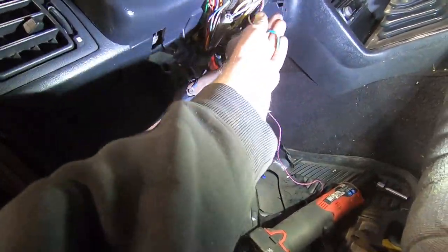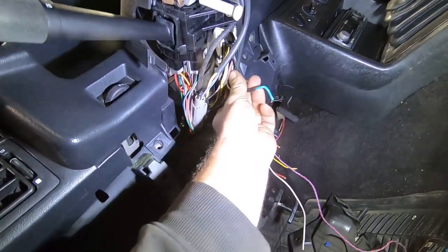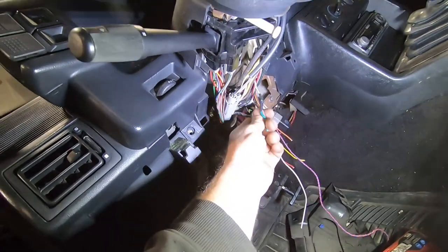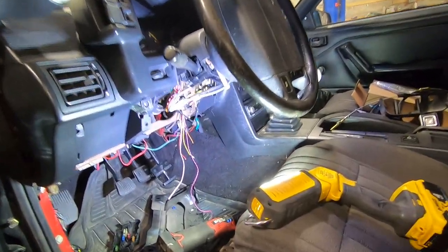All the same, the normal wires are tapped in here. I'm going to need to do some zip ties — you can see this wire is loose, so I'll make sure all this stuff is tie-wrapped in. I need to reconnect the white with the pink, which is your main starting wire. Going to go ahead now, pull that radio out, and see what we've got hiding behind there.